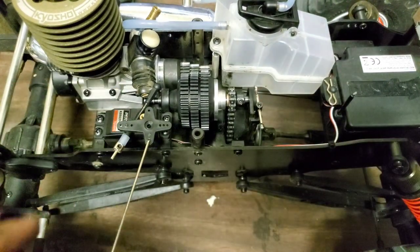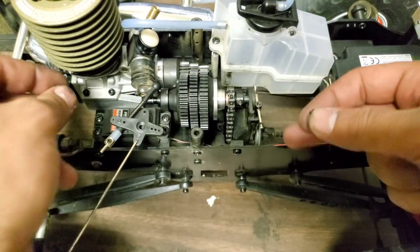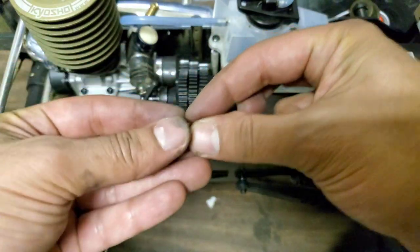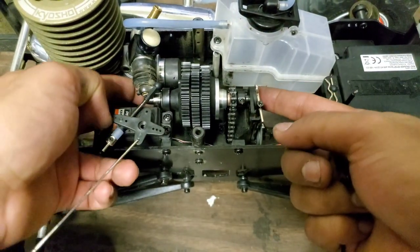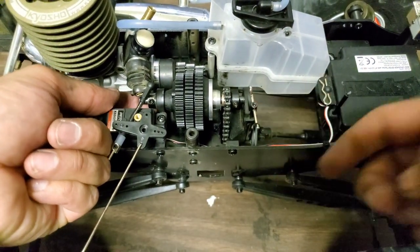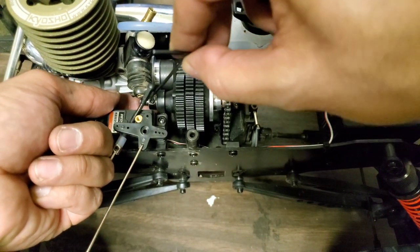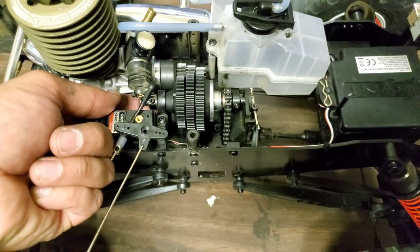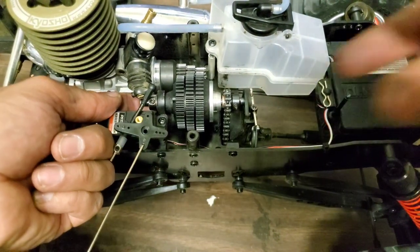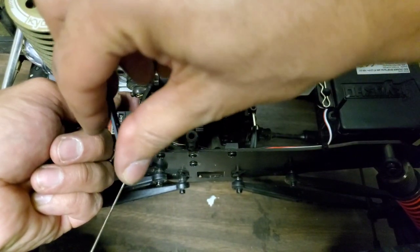There'll be a little slop here and there, that's fine. Now also put the other collar on the other side — don't forget the washer. Stick the washer in, then our other collar. I'm going to be very careful in the future about that little pin. Right now: first-to-second gear set at two-and-a-half turns, second-to-third set at two turns. Tighter means later shift, looser means earlier — so first-to-second is earlier, second-to-third is later. We'll still need to tweak it, but we'll see when we get there.